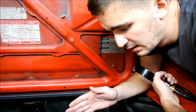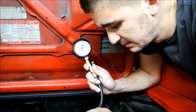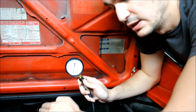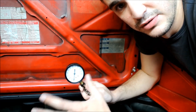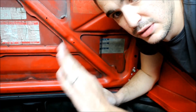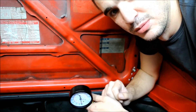I have disconnected my injectors, disconnected my ignition coil, and removed my spark plugs, so I'm ready to do the compression test. I'm now going to screw in the compression tester into cylinder number one and test each cylinder starting with one, proceeding to two, three, and four. We crank the engine four to five, maybe even six times until the pressure on the tester builds up and we get a reading. It's also very important to keep the throttle wide open while testing compression. Fingers crossed — it's time for the moment of truth.